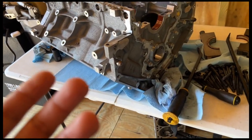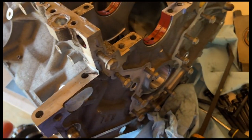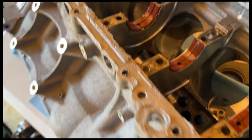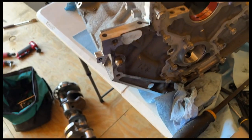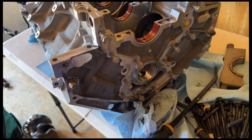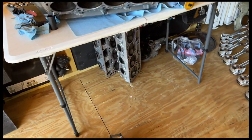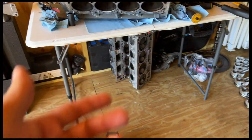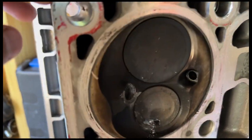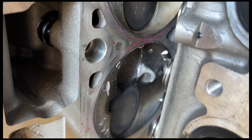I'll have a spare 427 in hand, God forbid I ever break one or need it for one of my other LT cars. The crankshaft cannot be reused for a 427 — I need a four-inch stroke and a 4.125 bore. Overall though, for the most part, the engine is actually savable. The cylinder heads took the most beating, which I showed you guys. Here they are — that's where it's missing the valve, and you can see the other one is all chewed up. But honestly, it's not too bad.